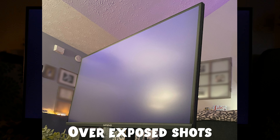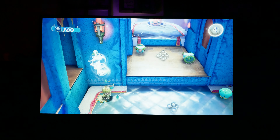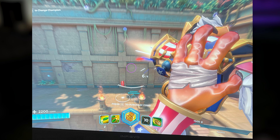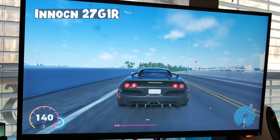Surprisingly, with this VA panel we get pretty good color reproduction. In a black crush test, I can see all the way up to box 1 really easily. Backlight bleed is a non-issue — sitting in the darkness it looks fine. Even in pictures you can tell there are lights on inside broadcasting the image across the panel, but I can't detect anywhere that would be problematic with backlight bleed. That doesn't mean every panel will be fine, but I don't encounter it here. As for ghosting, I have to really force myself to find it — this panel does a really good job keeping ghosting minimal. In some pretty extreme motions reviewing stills, I was able to find some, but it's extremely minimal.